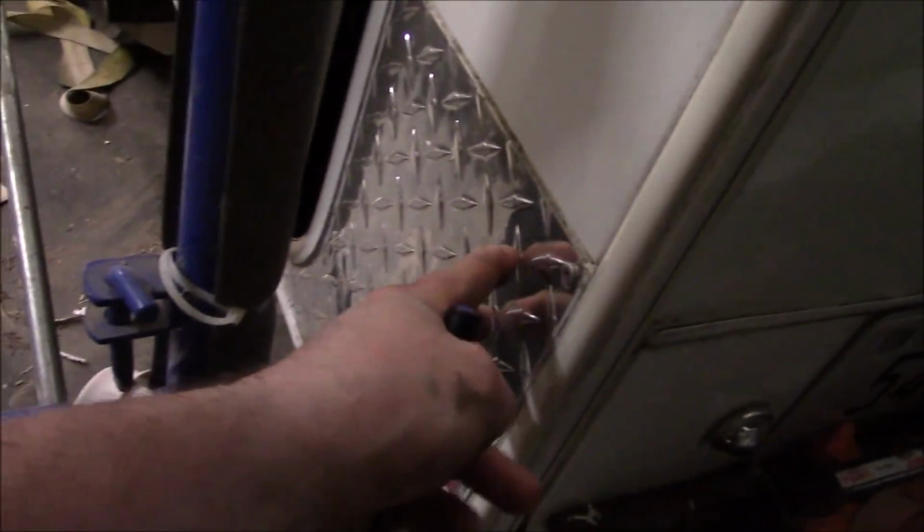And this, a while back, I guess somebody had done some repairs on this. So this may be all kind of related, but I've got four of these to do. And if they're all in wood, that's probably the biggest problem I see right there. That little 2x2, that's all it is. That thing is not going to be able to handle all that stress coming down. That's what happened. Split all that wood in there.